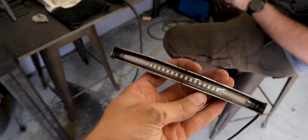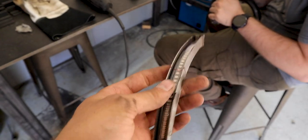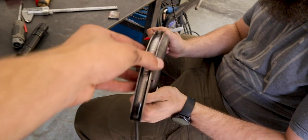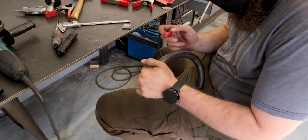So Cal's gonna be wearing the same style taillight that I had in my bike. They're recessed into the rear bar. So started by making this little housing to house the light, and then it's gonna sit inside the back hoop of the seat, and we'll cut a hole for that and weld that right in so that'll sit nice and flush.